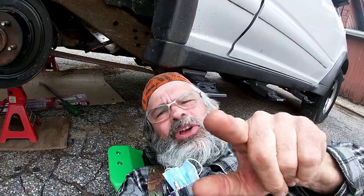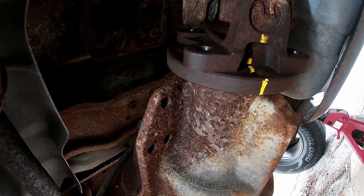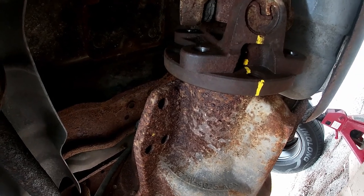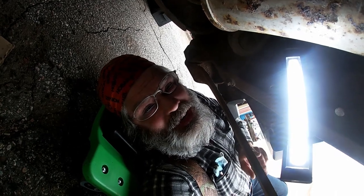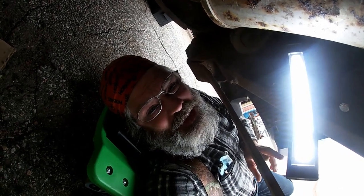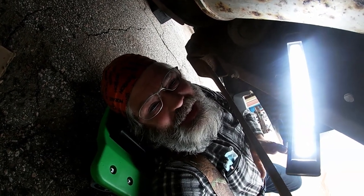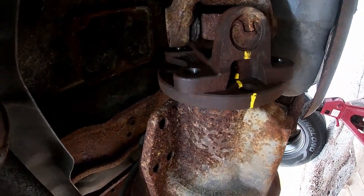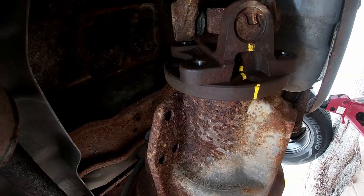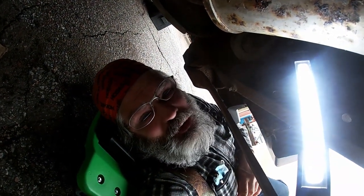Anyway, I digress. Now let's take a look at the drive shaft. Mark its alignment, it's a balanced assembly. That's what my yellow paint marks are for. Take the four 12-point bolts out. To do that, you're gonna need some leverage. Get a long extendo ratcheting half inch. Yeah, leverage. And then finally, a pry bar to connect it to. There's a little boss, which is a circular ring shelf that holds that drive shaft up.